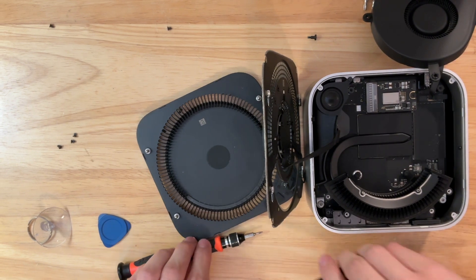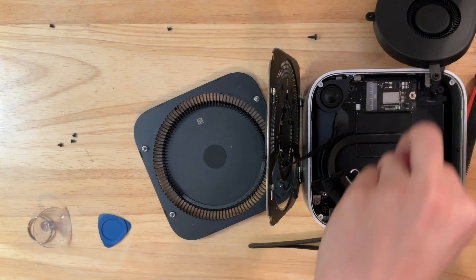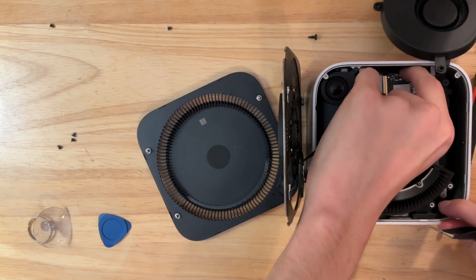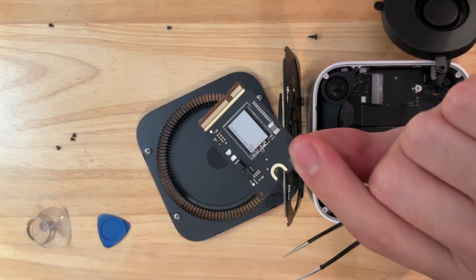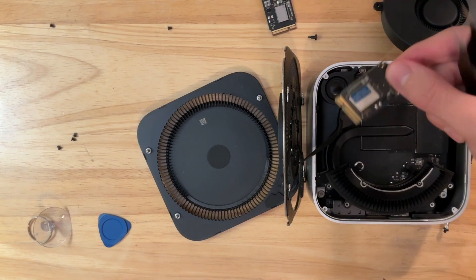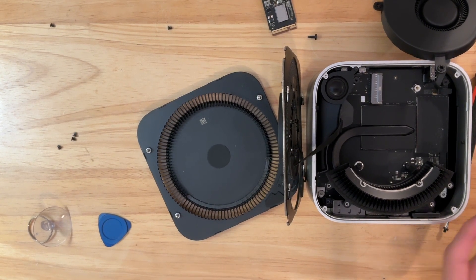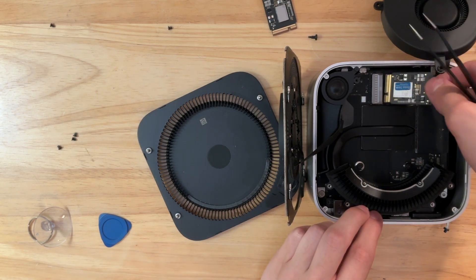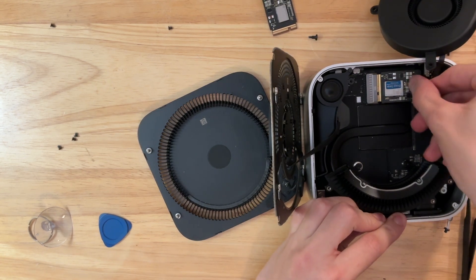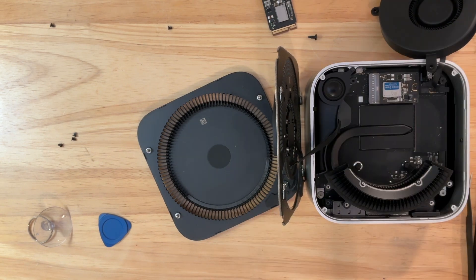Right here is our little SSD. So to get this out we're going to use the tool — this is a tight fella. Now we got our SSD out, and it says to use tweezers right here — just simply pull it out. Let's wiggle it out. And there's our SSD. It does have two NANDs right there — this is our 256GB. We're setting this aside and right here is our 2TB replacement. It does have a little sticker on it; looks like we have to keep it on. This goes in at an angle because of the M.2 form factor. We got it in correctly, just wiggle it in. That's in. Then we're going to screw this in — it's good to just screw it in. Then we need to put everything back together.